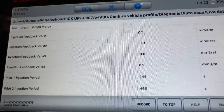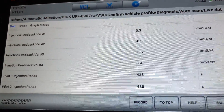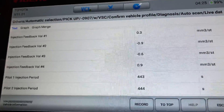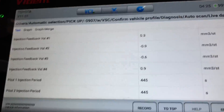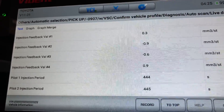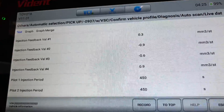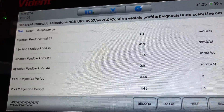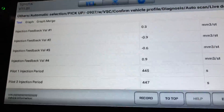There's much more to it than just cylinders 1, 2, 3, 4. If they're 3s or anywhere near it, the injectors are rubbish. You can get close to 2s — 1.8 is quite common even with new injectors. But they should come into check by the time the vehicle warms up pretty quickly. And you'll see the same thing 6 months later, a year later, 2 years later — it won't really change if there's not a problem. If there's a problem, it's just going to get worse.